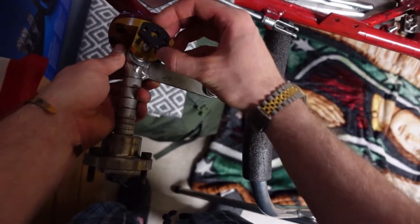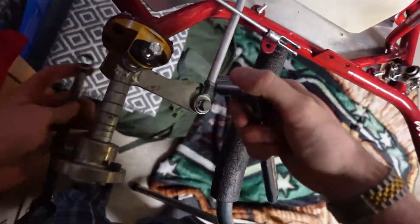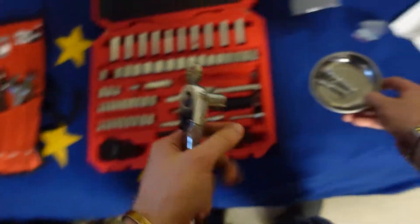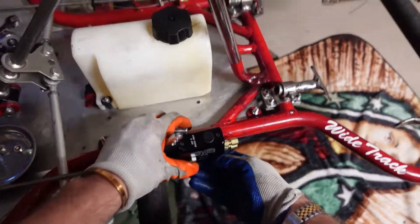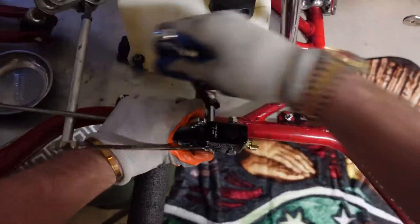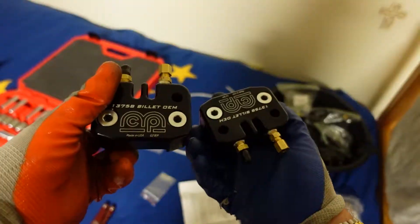I set this cart at zero camber degrees. All of this is done with no drill — just a wrench and a socket, so please be proud of me. Now we're fitting the front master cylinder of the brake — this is mainly where the brake fluid is stored and then pumped through the brake lines to compress the brake pads. Tightening this here on the front. That metal rod connects to my brake pedal — very simple but also very complex seeing how it all comes together.